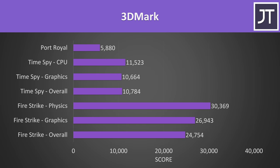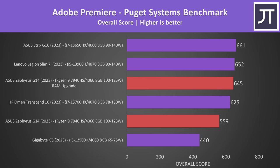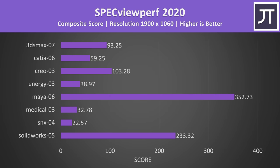In Adobe Photoshop, without extra RAM last year's G14 was faster as that came with a stick installed - adding the RAM gets a 35% higher score. The Adobe Premiere test recently changed, but adding a stick of memory gets a 15% higher score. GPU power matters more in DaVinci Resolve, where the extra memory only gave a 4% boost, though interestingly the G14's 4060 scored higher compared to the 4070 in two other slimmer laptops. In Blender, all 4060 results were very close together and even the 4070 doesn't get you that much extra here.